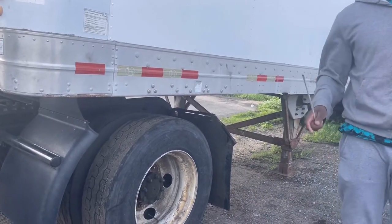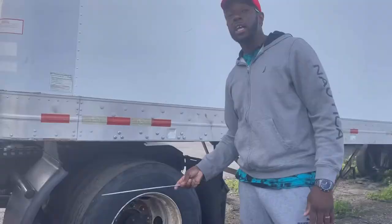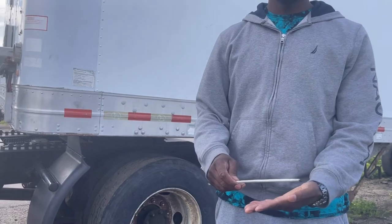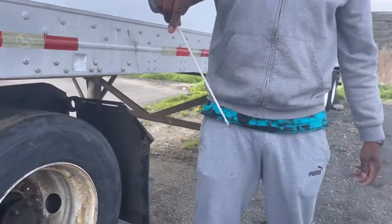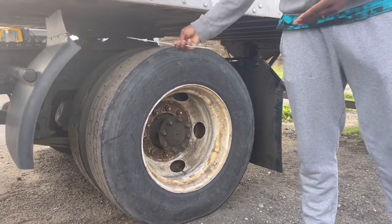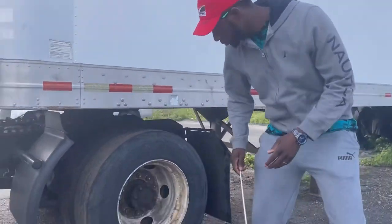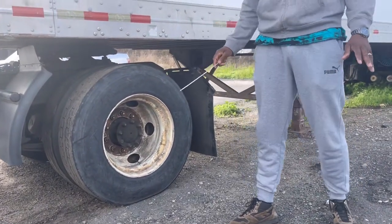There is no space between my trailer apron and my fifth wheel. If I were to check my fifth wheel skid plates, they would be properly lubricated. My fifth wheel is securely mounted to the fifth wheel platform. Pins and bolts in place. Fifth wheel lever is secure and in the lock position. Fifth wheel platform is not damaged. Secure.